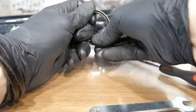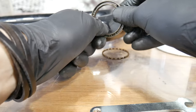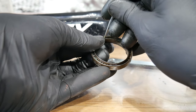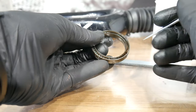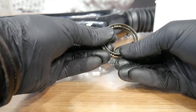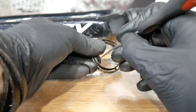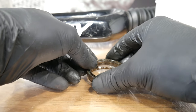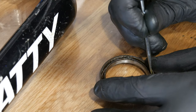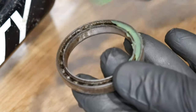If you're going to do it for the first time, just prepare your working area — it may all fall apart, it happened to me twice. Keep pressure on those bearing races so the balls will stay where they need to stay. Before putting the retainer back, push those balls around the whole circle so there won't be any differences in the distance. I want to have everything symmetrical so it will not fall apart. Now I'm putting the cage — the retainer — back and with the pick I'm placing each ball individually in its place.